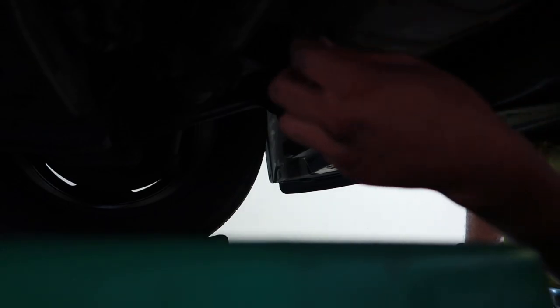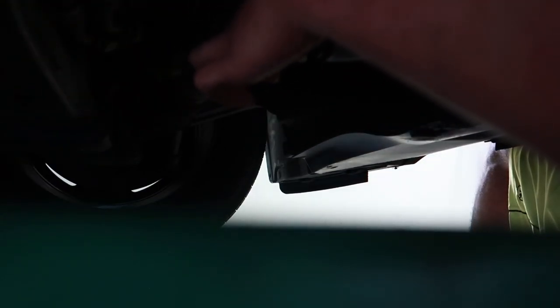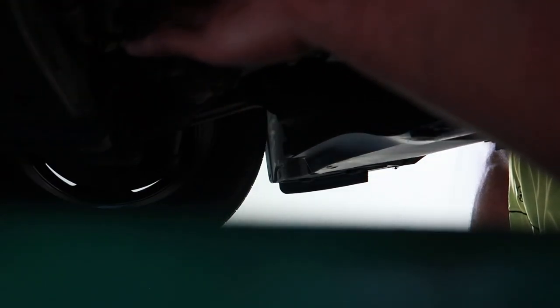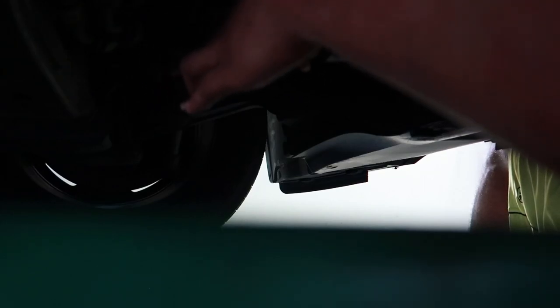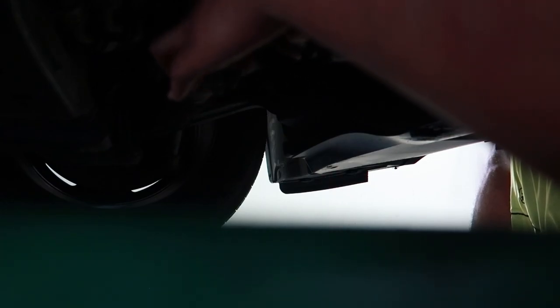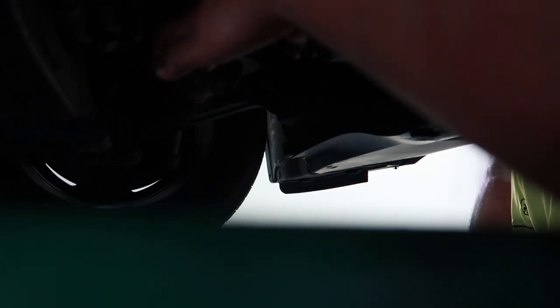Go ahead and crack this nut off, and once you've got it cracked you can take your wrench or ratchet off. Watch your hands because the oil will just start pouring out — even with my fingers being that low, let me prop them up a little bit. You can push the plug in to where you feel it being loose like that, and you'll see some drops of oil starting to come out.